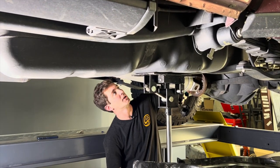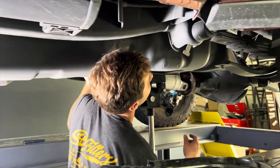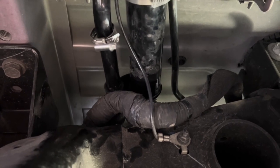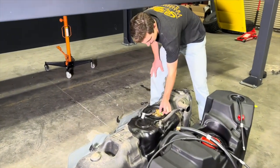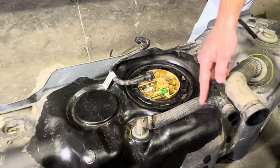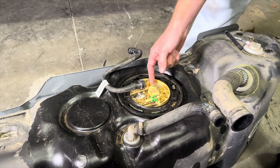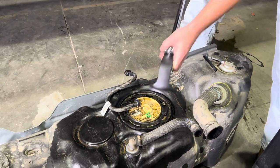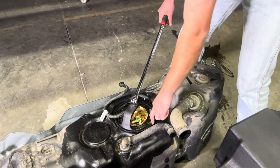We dropped the tank an inch or two. At this point, if you have any remaining lines on top of the sending unit, make sure you get those off along with your electrical connector. Then go over the top of the tank and pop off the filler neck and fill vent. With the tank out of the truck, you can better see the other fuel line connector — just squeeze in on the two tabs here to remove that. The electrical connector has a red locking tab that gets kicked over, then depress the tab and it comes right out. With that done, go ahead and get the locking ring removed using a locking ring removal tool, or a flathead or pry bar with a mallet.